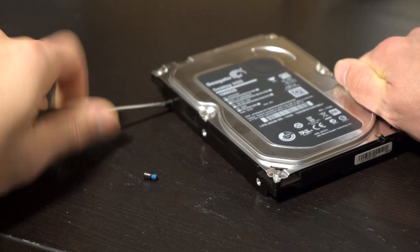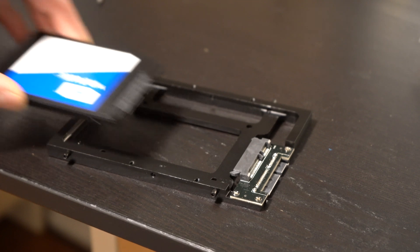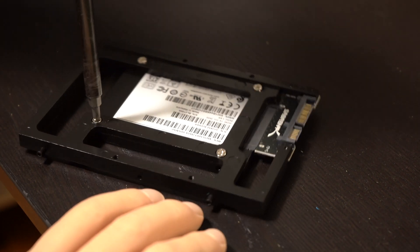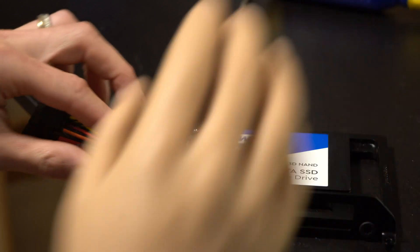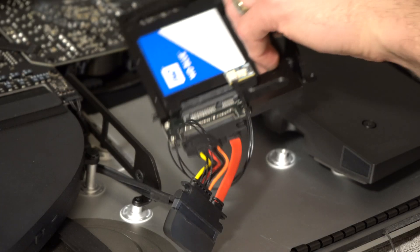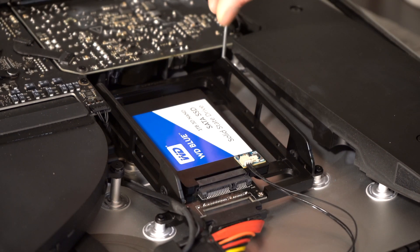Take the hard drive and remove the screws on the left side, then put those screws into the hard drive converter to make sure your solid state drive fits perfectly into your iMac. Push your hard drive into the socket on the converter and it should click into place. Turn the hard drive over and screw it in place using four included screws. Next, apply the temperature sensor to the hard drive — this is what lets the Mac know if your hard drive is overheating. It's a feature built into Apple's standard hard drives, but if you're replacing it, you need to install the sensor yourself. Stick it onto any available surface on the hard drive and plug the connector into the port on the bottom of the converter. After attaching the existing bracket to the side of the converter, bring it over to your iMac and plug the hard drive in. The wire with the temperature sensor may be a little bigger than the standard Apple hard drive, so you may need to twist or move it around to fit. Finally, screw the hard drive in using the existing screws.